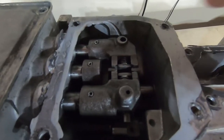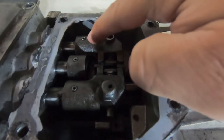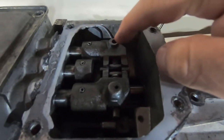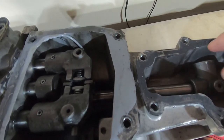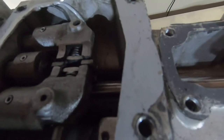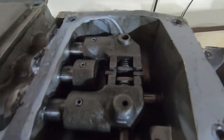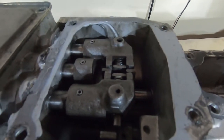In here you'll see some lugs with roll pins that you're going to want to knock out. The way this works: you have a rail from your rear shifter, and you can tell it moves pretty freely — that's because there's a shift lug missing. That's actually the shift lug I showed you earlier; we're going to have to reinstall that.